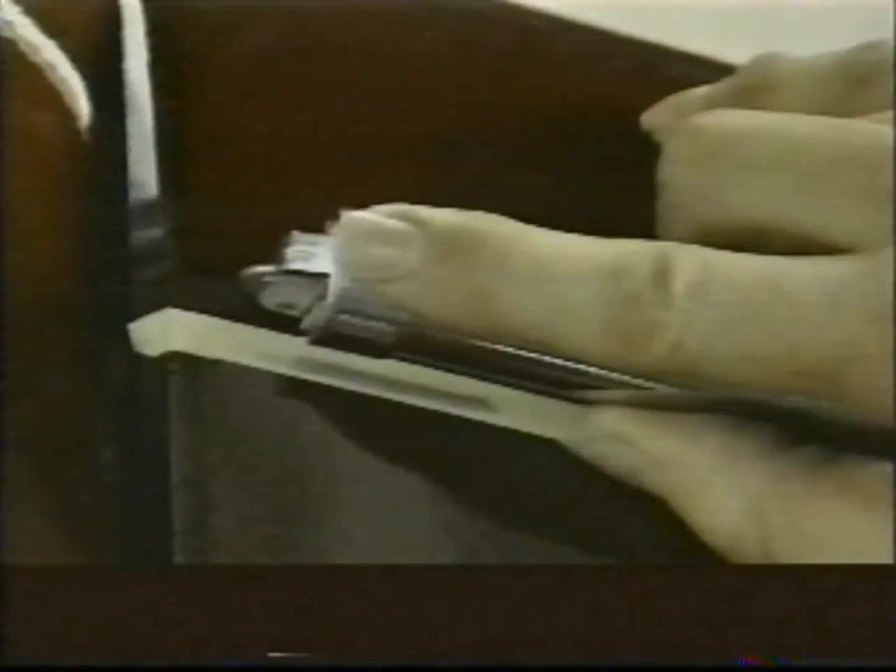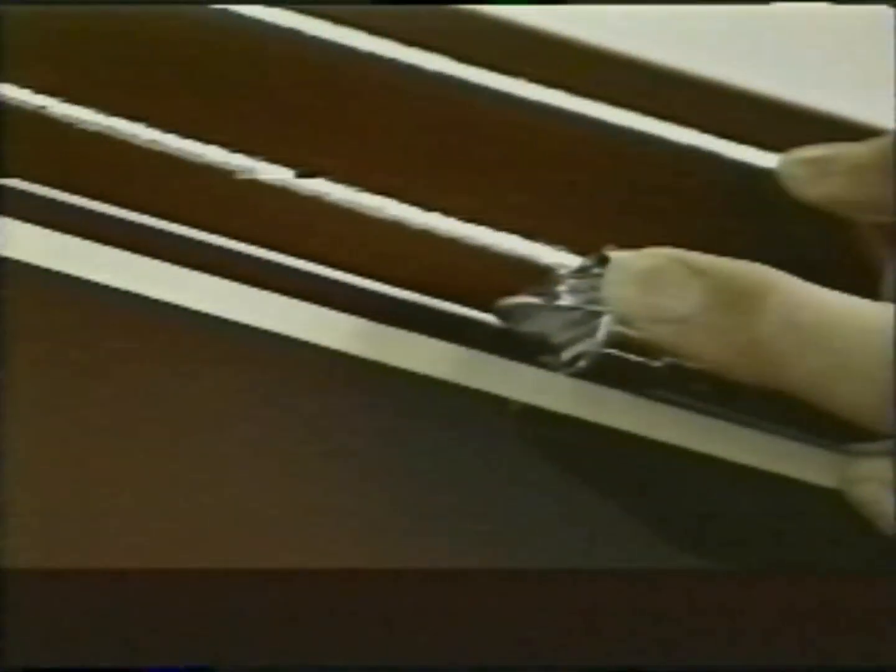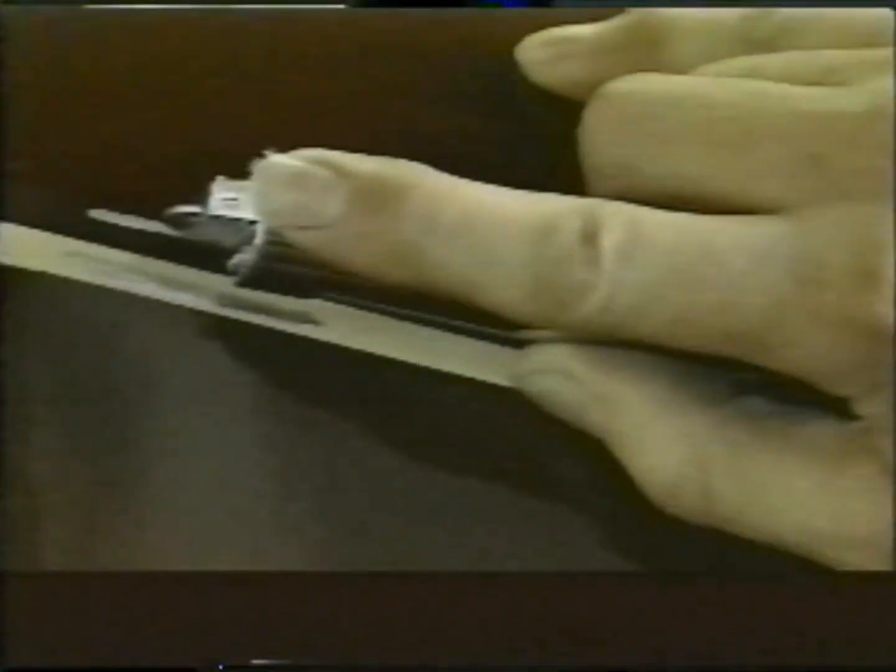When using tape as a reference line, keep your eye on the space and maintain an even distance between the tape and the stripe. If you find that the space is increasing or decreasing, make a gradual adjustment and the correction won't be noticed.